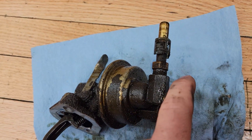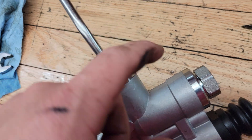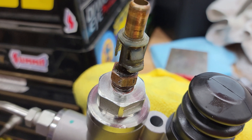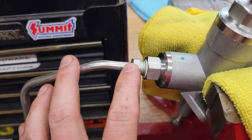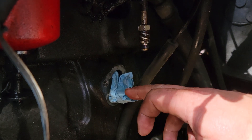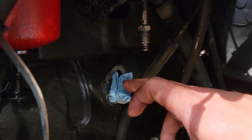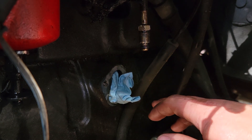Now that we've got the old pump off the truck, we want to take this quick disconnect fitting and put it onto the new pump. I'm going to throw a bit of Permatex thread sealant onto the threads before I install it into the new pump. I've got the new fitting installed with a little bit of thread sealant, as well as the hose loose fitted onto the pump. I've put a blue shop towel in here to catch any debris, because this goes right into the camshaft. I'll take a flat-bladed wide screwdriver and scrape off the mating surface and clean it up as best I can before I put the new pump on.